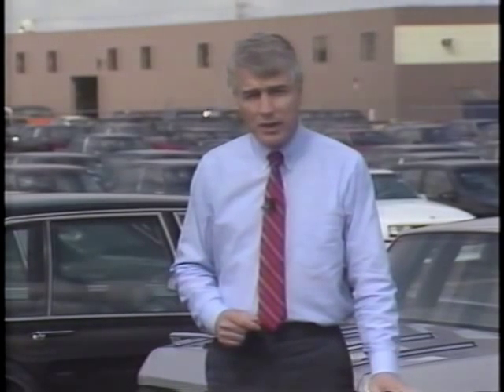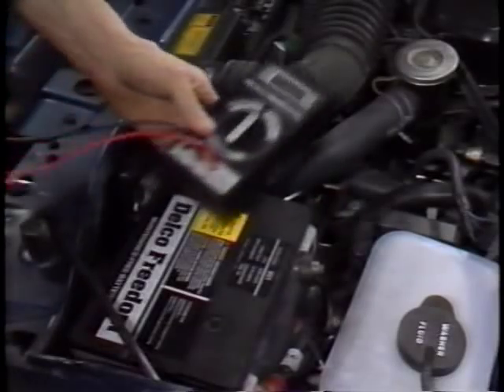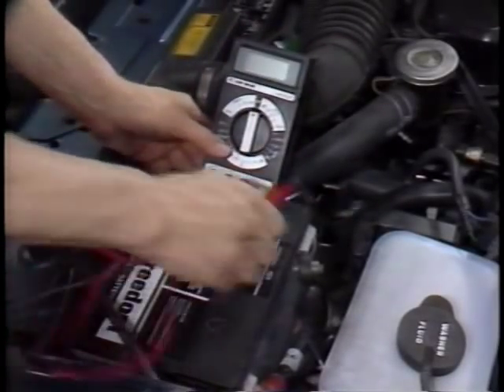In all likelihood, vehicles that are unused for two months even at 32°F will not start because of self-discharge. The natural discharging process is accelerated through another process called parasitic drain — a continuous current draw on the battery through parasitic loads such as small electronic devices continuously draining small amounts of current, including things such as the digital clock and electronic engine controls.